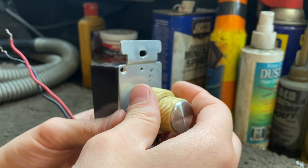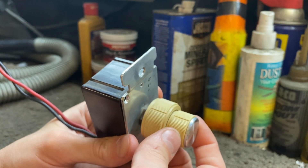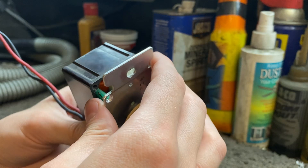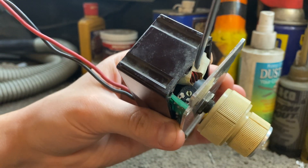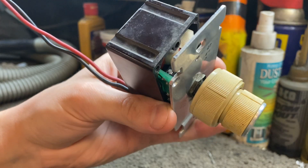If you don't want a light kit with the fan, what you're going to want to do is click the front knob into the on position, and then start turning the trim pot to the right until the fan starts and runs reliably.